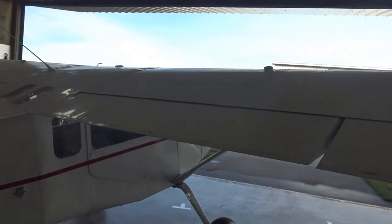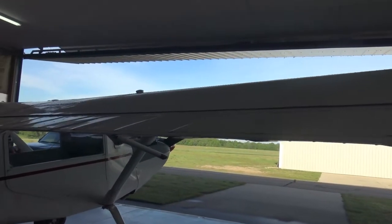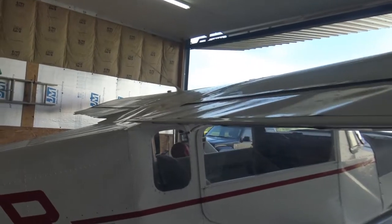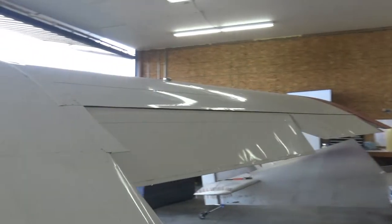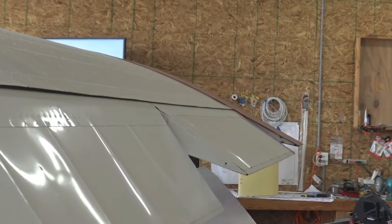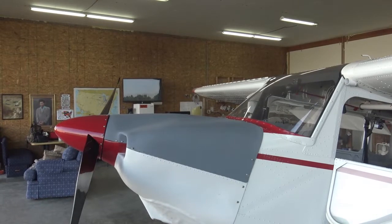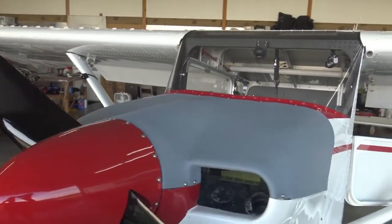Big flaps and flapperons. Also a negative setting on the flaps and the flapperons — negative six degrees. Kind of hard to see, but it's there. You can see it across the airplane on the other side. With the flaps at 30 degrees — a substantial amount of flap — and six degrees droop on the flapperon, you can see it against the tip. Slow speed is pretty good. I was showing zero airspeed. We know that can't be, but that's pretty darn slow.